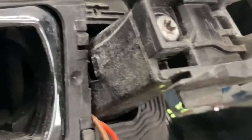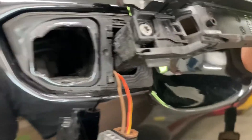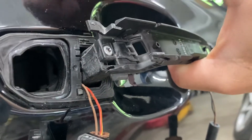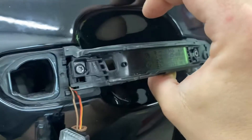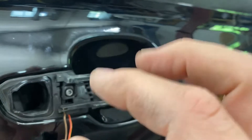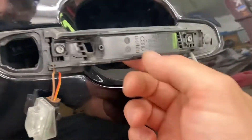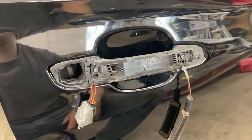You can do it yourself or have somebody help you. Have them hold a screwdriver or some sort of tool in the hole to hold the actual mechanism part out. Then take your screws back out — front and rear — and with that being held out, the plastic handle part itself just slipped all the way in, just that little bit extra it needed. Put the screws back in and tighten them up. I don't have it fully back together yet, but I can already tell that was my issue. Hopefully this video helped somebody.